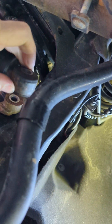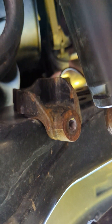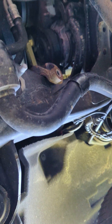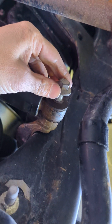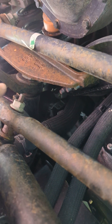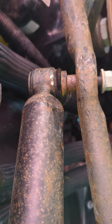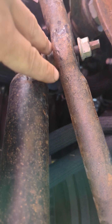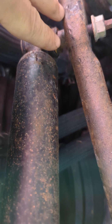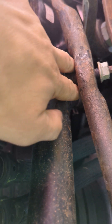There's a bolt sitting here — this is the bracket I was telling you I'm not going to change. I don't think you need it. There's a 15 millimeter here that I unscrewed, and an 18 millimeter here. In AutoZone or any other stores there's a special fork — you put the fork in the lip here and hit it with a hammer to pop it out. You can also use an air gun with the fork; it's faster.